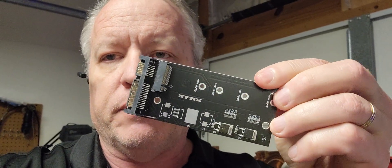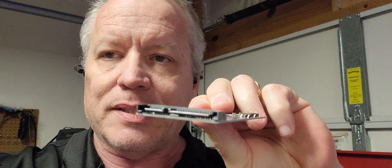When you take an NVMe style configuration setup and use what's called a pairing card — this is a pairing card — right there you can see where the NVMe sits on the card, and it's fully compatible to SATA or SAS. You stick it in and it's so light and functional you could probably just let it sit on the contact without any support, as long as you're not jarring your NAS. NASs are usually able to spec for 2.5-inch versus 3.5-inch in their caddy designs, which lets you go the alternate route and use a 2.5-inch SSD drive.